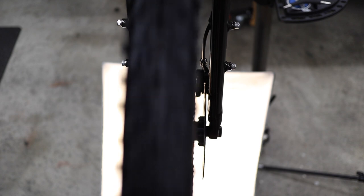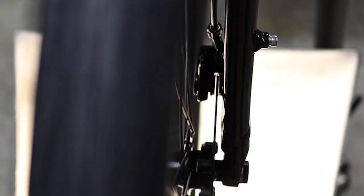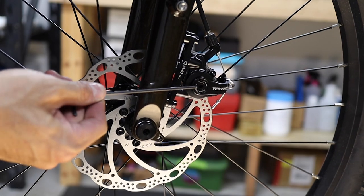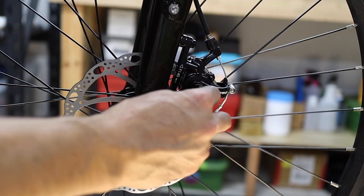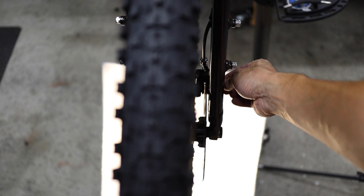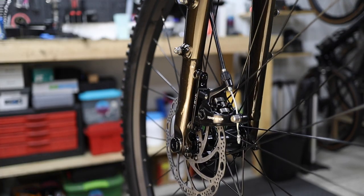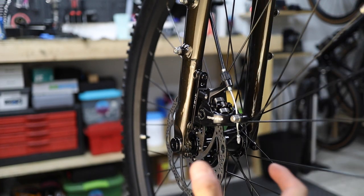For the brakes, there may be a little bit of setup required. These Tektro brakes are dual piston actuated, meaning that both brake pads move inward toward the rotor when you squeeze the brake lever. The calipers also have a dual-sided pad adjustment, which allows you to bring the pads closer to or further from the disc rotors using a 3mm Allen wrench. If you hear the brake pads rubbing when you spin the wheel, it's really helpful to shine a light behind the rotor, which should reveal where the rubbing is occurring. You can then make fine adjustments to each individual pad until the disc rub is gone. If you've reached the maximum pad displacement and you still have rubbing, you can also loosen the two caliper mounting bolts and slide the caliper itself laterally until there's an equal gap on either side of the rotor.